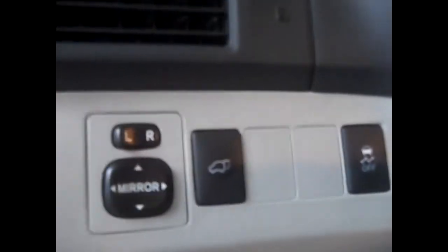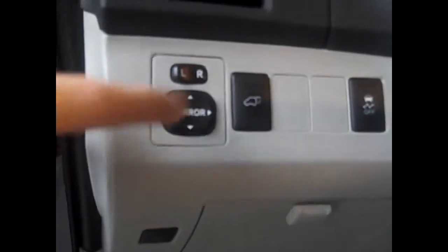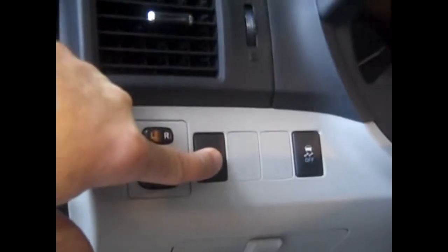The other thing is there's a switch on the dash. In this particular vehicle — it's a Venza — there is a mode on the actual dash which allows the feature to be turned off or on. If we push it in, the hatch will not open, and you will hear a series of two beeps. The button has to be in the out position for the hatch to work.